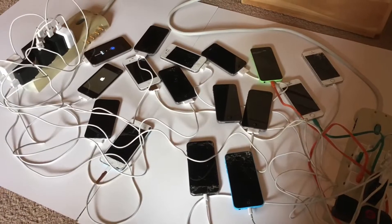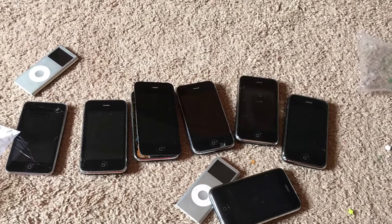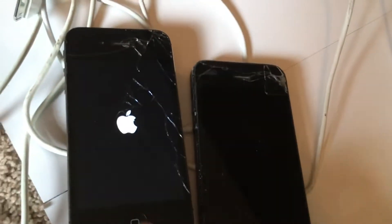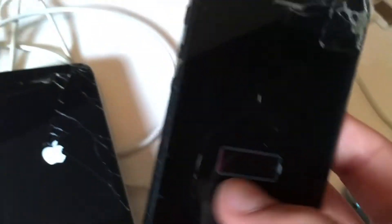This one is pre-iOS 7 - iPhone 4S. So I'll be back. This 5C wasn't showing any power, but the charge port was so dirty, and when I cleaned it out a little bit it is now charging. So that's awesome. This is an insane deal - so much of this works more than I thought. These two are looping; this one has the common battery loop to Apple logo, so it might just need a new battery.